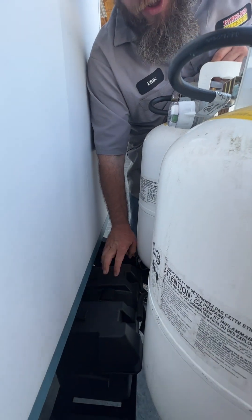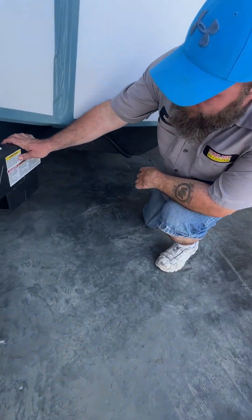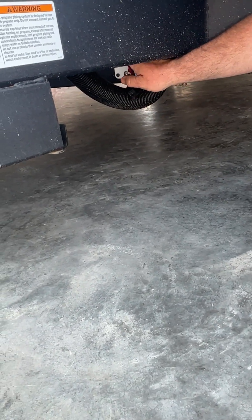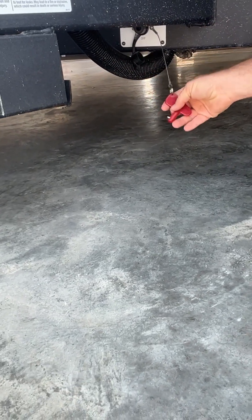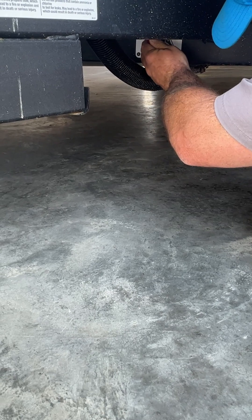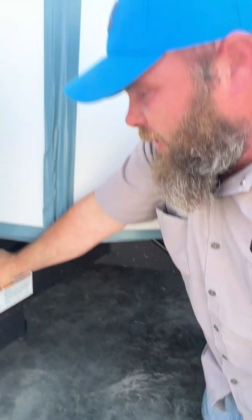Back behind there is where our battery is located. It's a 24-series deep-cycle marine RV-style battery. Back here is where your battery disconnect is located. Whenever you're not using your camper, you're going to turn this key and pull it out — it disconnects the camper from the battery so anything left on wouldn't potentially drain it. Whenever you are using your coach, you do want that key in and in that twisted lock position.